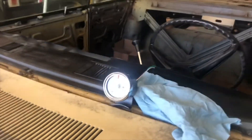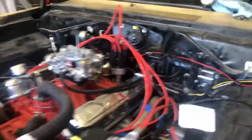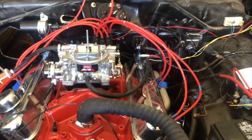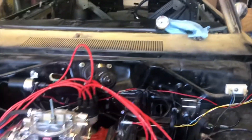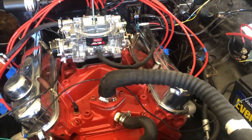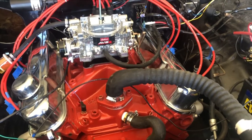I got my tach wired in. The tach is just wired in loosely right now — nothing in here is set up for permanent use. I went ahead and just grounded it out back there and put the hot wire on the back of the panel. I didn't even hook up the white wire because we don't need lights. At this point, we're going to grab a screwdriver for our throttle so we can set it once it starts up and monitor our RPMs on our tach so we can break this engine in. So I'm going to go get all that set up, get something to drink, and then we are going to fire this engine for the first time in many, many years.